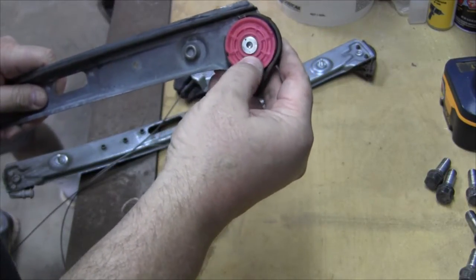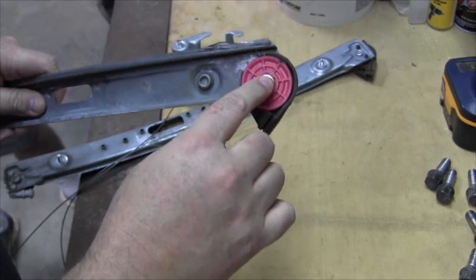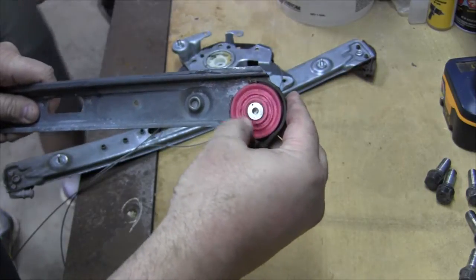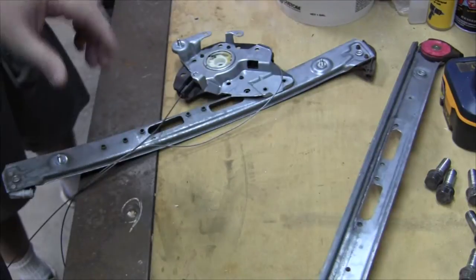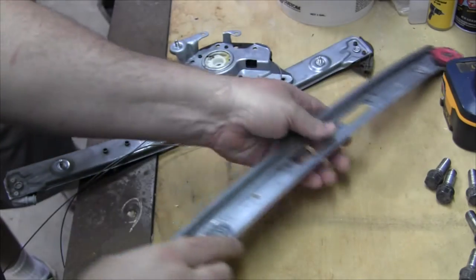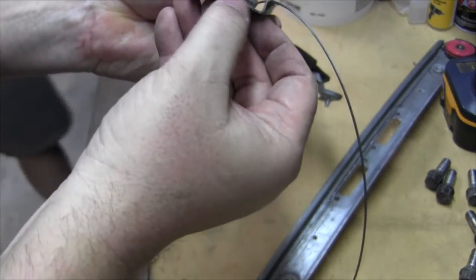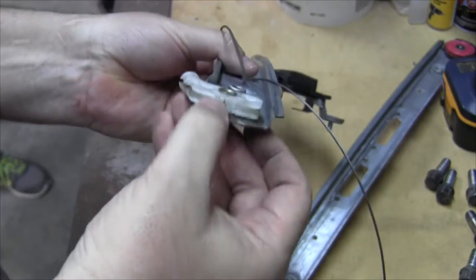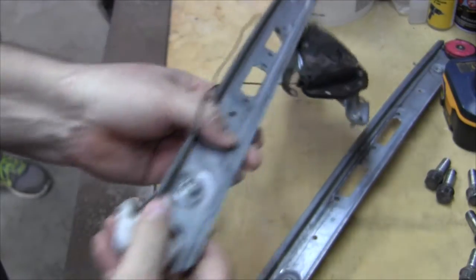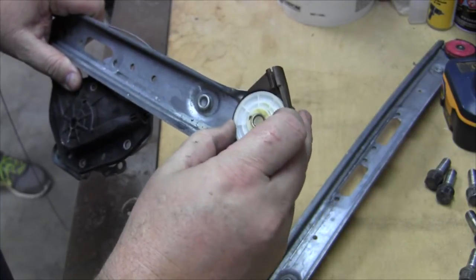And when I first started moving this, I could hear that little cracking grinding in here, and now it's freed up. So I think that is where that grinding was. I don't hear it at all now, but I could hear the clicking and the grinding on that wheel. So I think that's where the noise was, in the wheel. Actually, the bearing's fine. It was running without an issue. And then the same thing on this side. If I flip this over, the bottom part of this track, again, there's no roller. The cable just slides across this plastic. And then on this top side, there's a wheel, and the bearings seem to be fine.